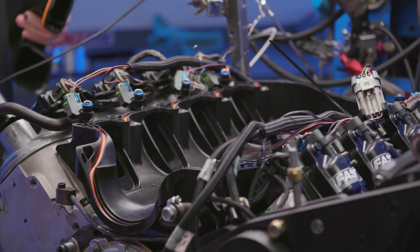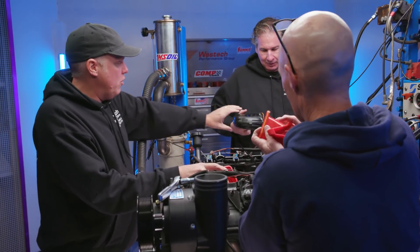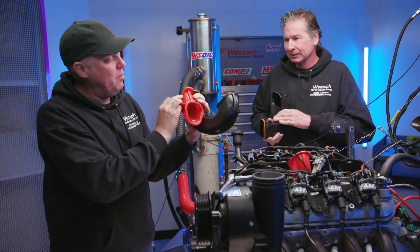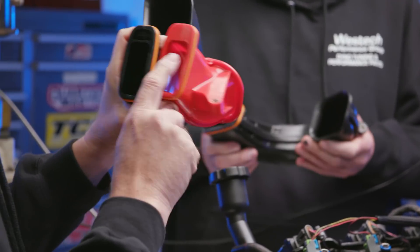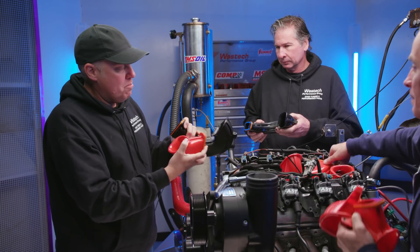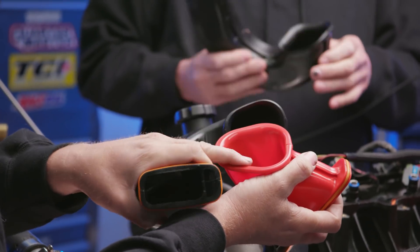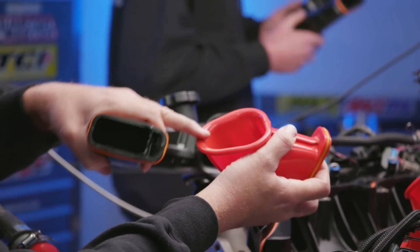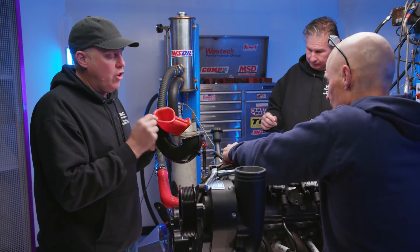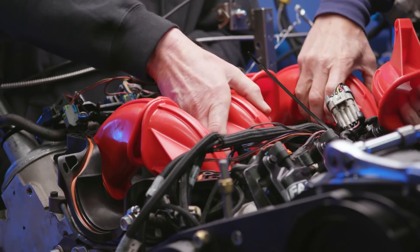That's actually a really cool intake manifold. So what is the actual difference between the runner length that we're seeing here? Three times? Yeah, that's quite a bit. Wow. So you can see this is the part that goes up against the cylinder head and this is the mouth of the port. You'll notice they're actually bell-mouthed more nicely on these red ones because there's room to do that — that curve right here, the radius entry all the way around, which is way better for airflow than just a sharp edge. It makes a significant difference.